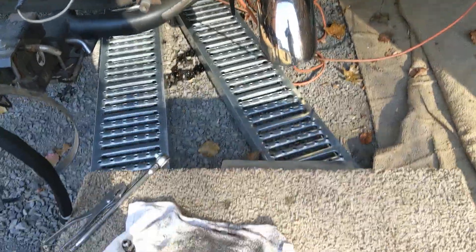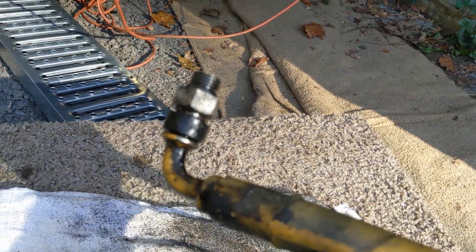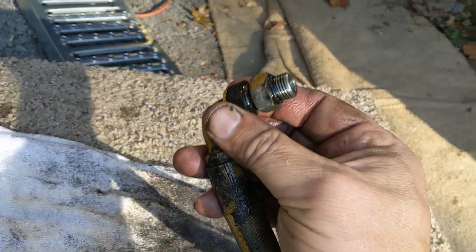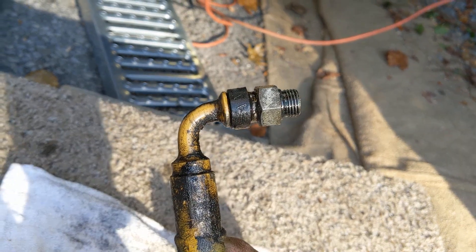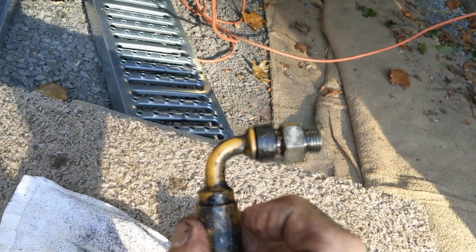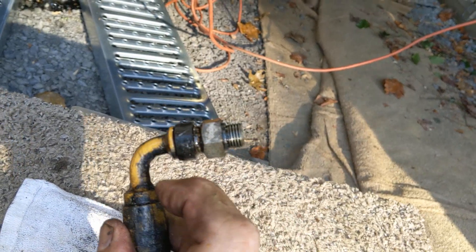I finally got this out of the pump. This is the CAT high-pressure line, and there is the fitting that goes into the back of the pump — it's got an O-ring on it. My leak is here where this was allowed to flex, and the line looks a little rough where it's starting to pop loose. This carries about 3,000 PSI from what I understand. The IFS kit comes with an adapter that goes from here and up so their line connects straight to it — I think with a JIC connection. Now I'm going to look in the kit, get the part, put it on the back of the pump, and start putting this back together.